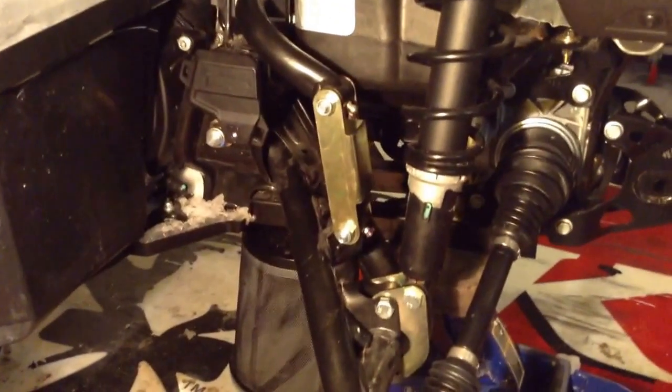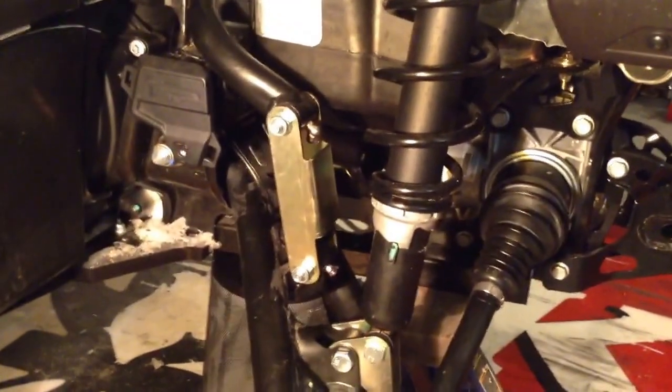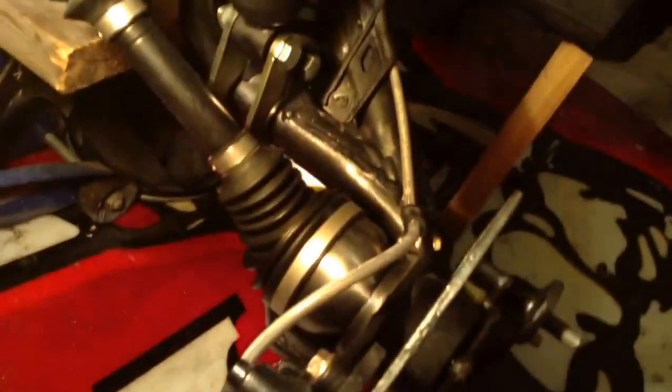I'll show you the back and give you an idea of that. This is basically the lift for the back — that's all it has to it. Those two components here and this component here. Again, all it really is is relocating the shocks. It's very simple. On the opposite side of the bike, you have to pull the hub because there's a spacer that goes between the hub — it goes right in here. So you have to pull your hub off and pull your main bolt out right in there, but that's pretty easy to do as well. And that's all it is to the lift.